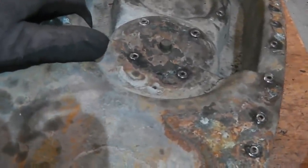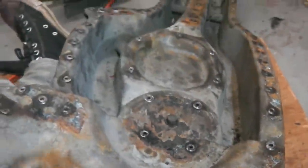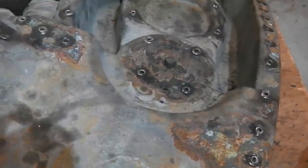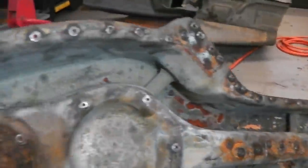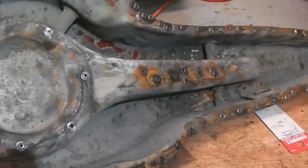Now this one, you can put quite a nice little bit of paint in this one because there's plenty of room away from the welds on the walls, certainly centre section there, so we'll get that very, very clean. I think this will come up quite nice. Now that has been dipped, and they can only get so much. That's why you've got to finish the job off with paint, so it doesn't get everything. But we've got to every panel, because if you think about this car now, we've been all over this in every cavity, so there actually won't be any cavities that we haven't covered, so we can rest at night knowing that all these internal areas are nicely treated and that we know exactly the state of play. This could have all rotted away, but it hasn't.